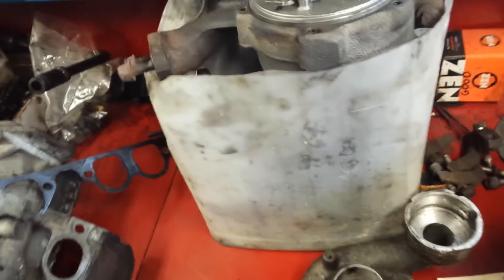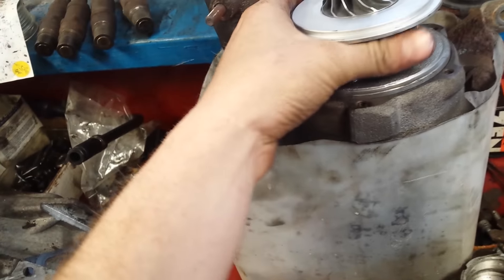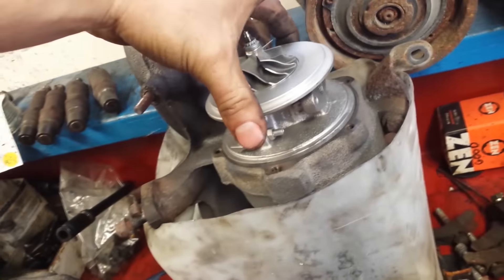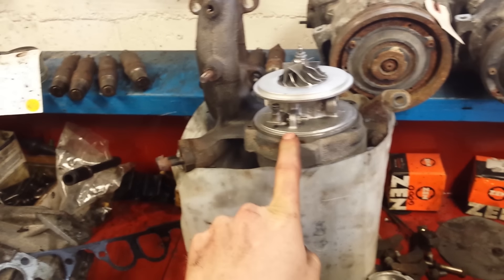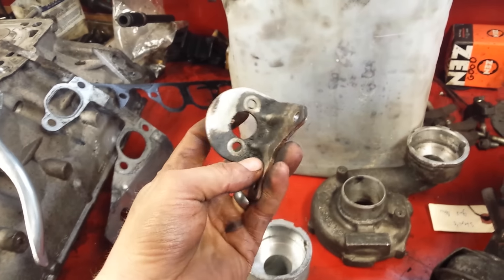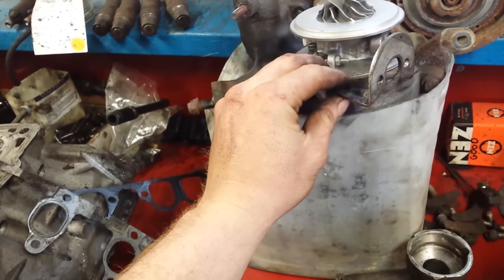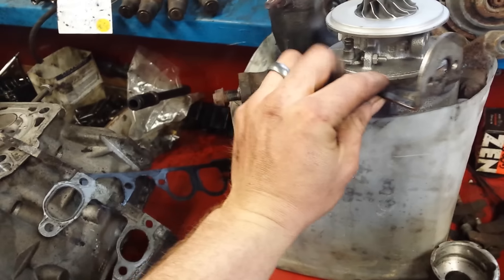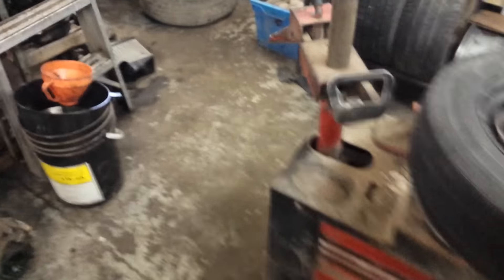With this VNT 17, it's going to go on only one way — there's a pin. There are a couple different ways I can do this turbo — this would be an upgrade for both the ALH and the BW. I can go with a normal ALH with the vacuum actuator, like that — so that moves that guy like that.